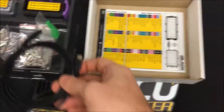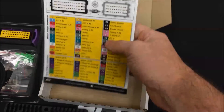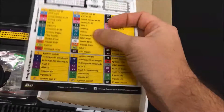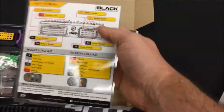USB to micro USB cable. One of my favorite features about the packaging with ECU Master products is that you get a laminated pinout card. That way it's not a piece of paper that gets destroyed in your car. If you make any changes to these inputs or have something assigned, you can always just scribble on here with a Sharpie. That way you've got a good reference in the vehicle if you need to troubleshoot, diagnose, or repin anything later.